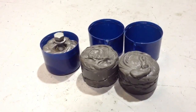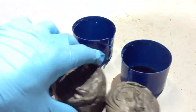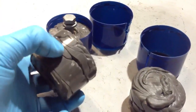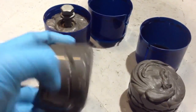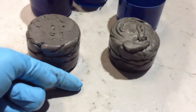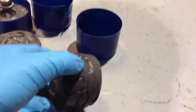The results of the structural foam test pots are here - they've all cured absolutely fine within 24 hours. We've just broken those out of the cases and they're rock solid, sounds like a hockey puck. This is why we do testing, because it clearly shows they need to be backfilled. There are some air pockets and air gaps visible in our test versions, which is obviously apparent.